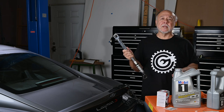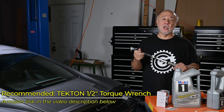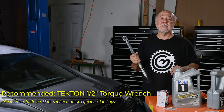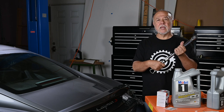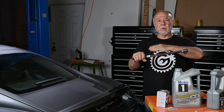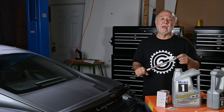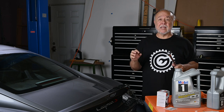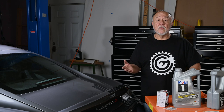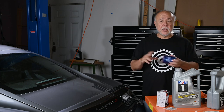If you don't have a torque wrench, go get one. A modern torque wrench is easy to use — you adjust the handle and it clicks when you reach the proper torque. I also have a torque driver that works in inch-pounds for small fasteners. Once you've drained all the oil, of course, you need to change the oil filter. And that's where the Cayman is different from any other car I own.